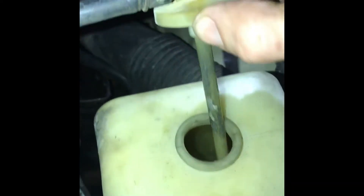First thing you're gonna want to do is drain the coolant. There's a nifty drain on the side of the block — a pet cock on the radiator, and also a drain on the side of the block. It's just 14 millimeters.